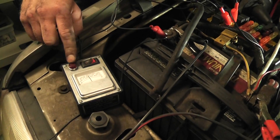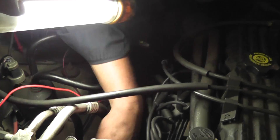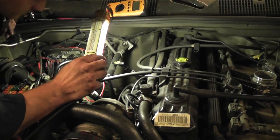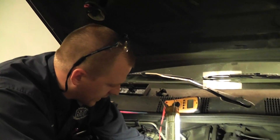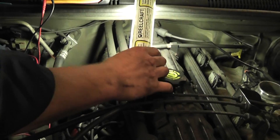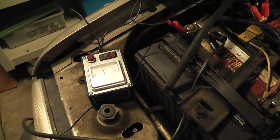We're going to watch this indicator and go through the harness. Starting with the alternator — I'm just looking for areas where heat and vibration is key for any intermittents. My O2 heaters, for sure. However, it was interesting when we plugged the crank sensor back in that the fuse blew. So I definitely want to focus on this harness back here. We're looking for this indicator to light, which will tell me that I've got a blown fuse.